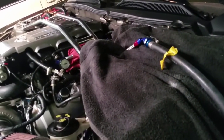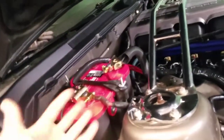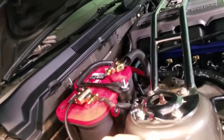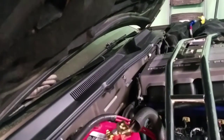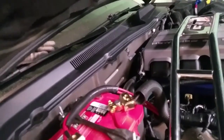I wasn't sure exactly what triggered the code and what caused it to stall. But I did have a negative battery cable that was a little loose, so we got it tightened down. It sat overnight and then I started it — it idled for about five minutes. The AFR was reading a little on the lean side, not dangerously lean, but leaner than normal. Then I gave it a few feather revs and after about a few seconds it started to stall out again, and I haven't been able to get it to start since.